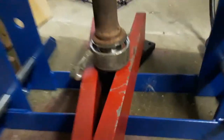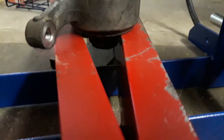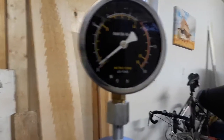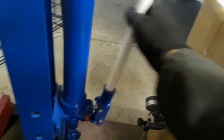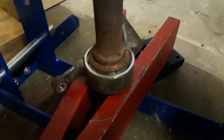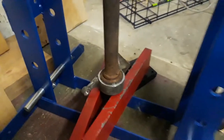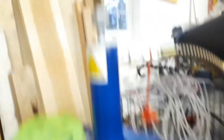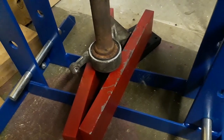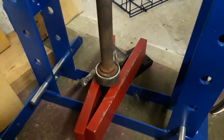Here is what I've got set up. We can pinch it as close as we want once the shaft is in. They've built this so we can't catch on there — just make sure everything is straight up and see what happens. It seems to be pushing together nicely with just a couple fingers of pressure. After a few more pumps, we definitely hit a stop — one ton pressure there. It just stops moving, stops creaking in. You should feel the same thing, and I'm sure we'll find the snap ring available to be pressed in next.